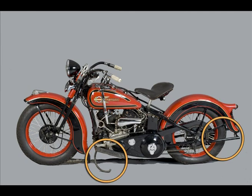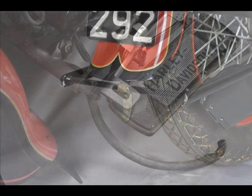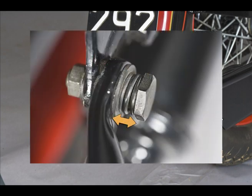The side stand, or jiffy stand, is an option, but it's hard to believe any solo bike left the showroom without one. This is in the parkerized finish, with a painted spring, like the clutch pedal, and there are no flats or wear marks underneath. The tubular rear stand is 1 year only on the 1936 VL, as is the stand catch and the smaller springs fitted on the pivot bolts. No deductions.